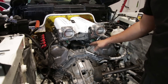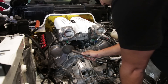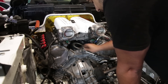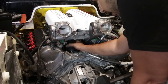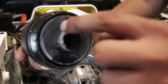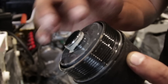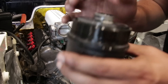I have already drained the oil, so there shouldn't be much coming out the bottom. When I take this oil filter off, I'm expecting to see a lot of moisture, which looks sort of milkshake-y. That makes a lot of people scared it has a blown head gasket, but there's no coolant in the oil and no oil in the coolant — this is all basically condensation from a piggy-rich E85 tune that's been sitting for three years and only turned on for five minutes at a time. And it turned out it just smells like E85, not coolant.